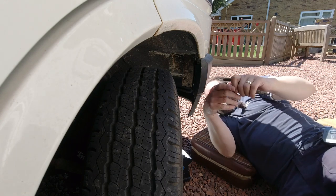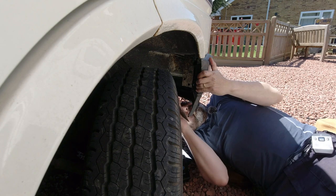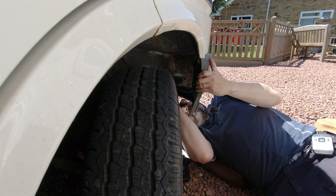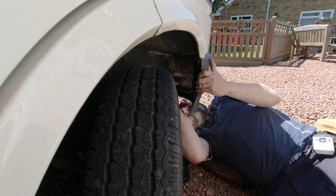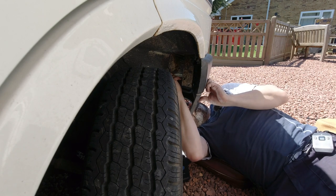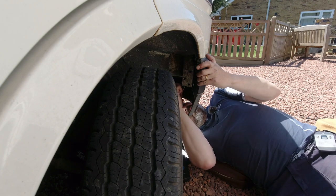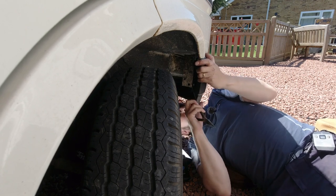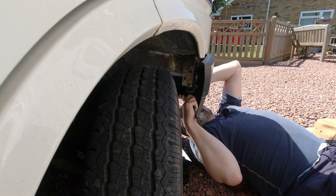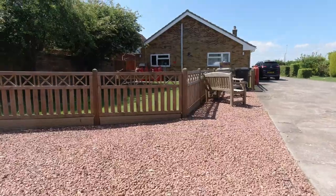I mentioned there were alternate methods of getting these out. For whatever reason I may have to use one of the alternates on this - they're slid onto a bracket and the bracket is plastic, you can remove the bracket. There's a plastic dowel that basically keeps some little claws expanded; if you pull that out, the bracket comes out. I think somebody's been here before me and tried to knock them through rather than pull them out, which is the wrong way.